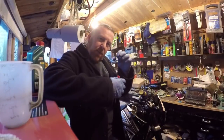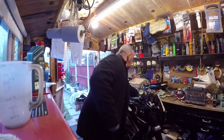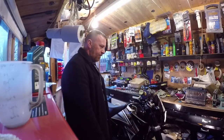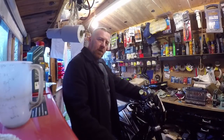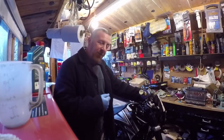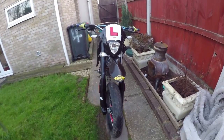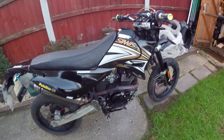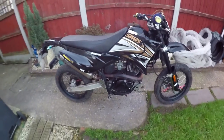The LexMoto has the vacuum on top — that is underneath, and I may have been able to get it with a small screwdriver. However, it starts a lot better now. I need to take it for a ride and see when it comes back when it's really warm, because you really should set it warm. I think that's bang on now. So — wash and clean, let's look at it outside.